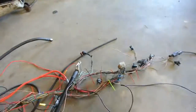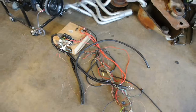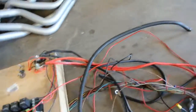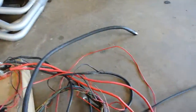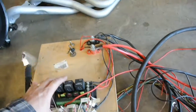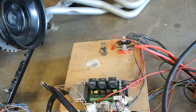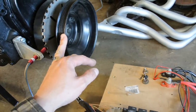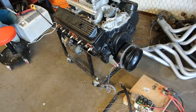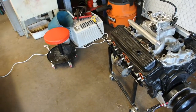This is an LS harness that I built just to test LS motors with a MegaSquirt box — the MegaSquirt's not here right now. Basically this cable breaks out to a little jump board and you plug it in back over here. I've got it wired up to do wasted spark so it can run pretty much any LS with coils that comes through here. I'm trying to get back on this and finish it out.